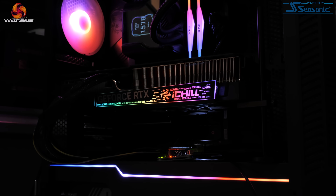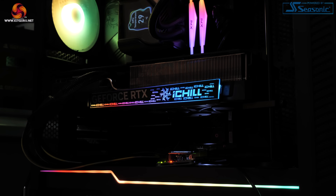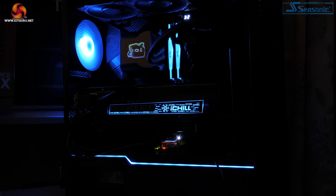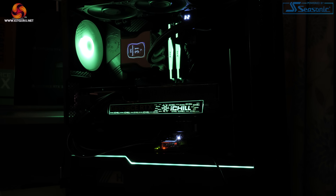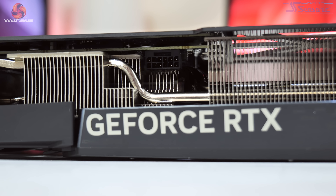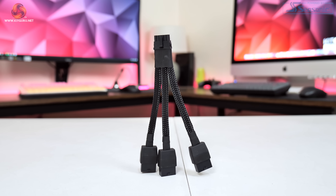I also really like the RGB lighting found on the front side of the card — it definitely matches the overall in-your-face aesthetic. By default it does a rainbow-style effect out of the box, but Inno3D does include an ARGB cable to synchronize the card's LEDs with the rest of your system if that's your preference. Power is of course supplied by the 12-volt high-power connector, but interestingly Inno3D actually includes a triple 8-pin adapter despite the 320W TGP. For context, the Gigabyte Gaming OC 4070 Ti can actually hit up to 340W TGP, but that card only comes with a dual 8-pin adapter — so stay tuned for later where I do some testing to find out whether the triple 8-pin adapter is really necessary.